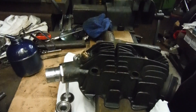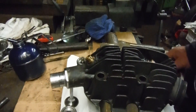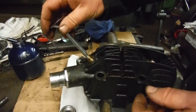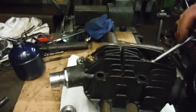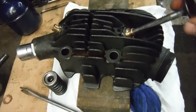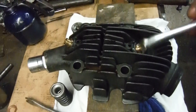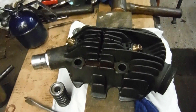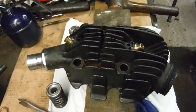We've got two replacement valve guides in that cylinder head now. Here's a little valve — it's a nice fit in that one, and a nice fit in that one too. What I'm going to do next is let the cylinder head cool down a little so I can handle it, then turn it over and try the valves in the guides the proper way around to see how close to the seats they are. I know I'm going to have to do some lapping to some degree — they're not going to land perfectly concentric. They rarely, if ever, do, and hopefully they won't be too far out.